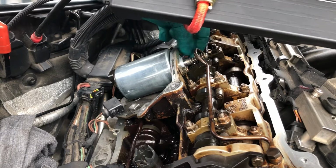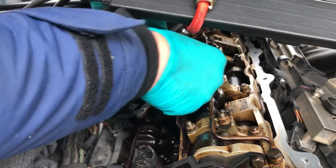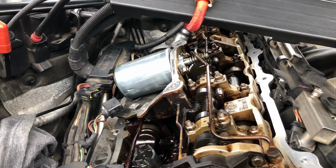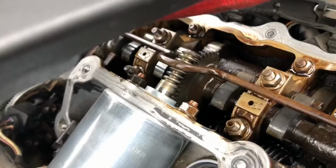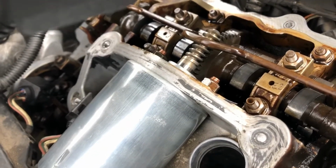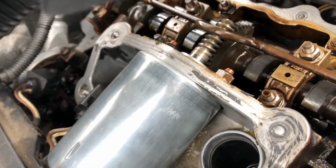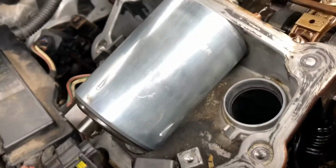And I am now just going to nip those up. Right, and that's all there is to it. We won't snap the connector on just yet because other things to do. Right, that's it all fitted back, tightened up the two 10mm nuts. There are no torque settings from BMW for those, so just nip them up nice and tight. Remember, they've got what look like copper coated threads there, so you don't want to muller them, but nice and snug and tight is absolutely fine.